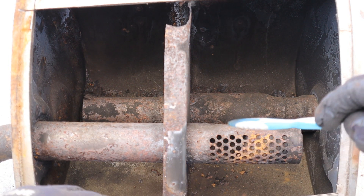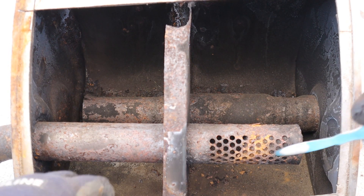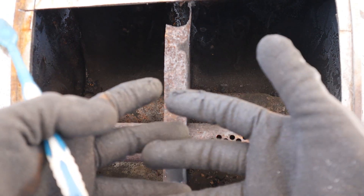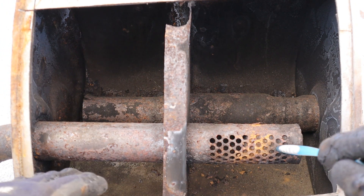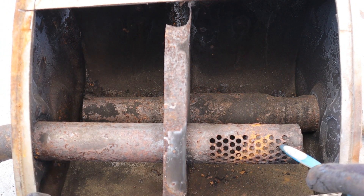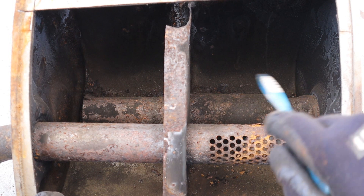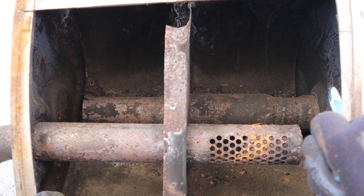There are some perforated holes where some exhaust gases are then going to escape into the first chamber. At the back of this pipe it's actually blocked completely with a glass-packed fiber. These fibers are fine little strands which are going to vibrate at different frequencies and cause them to come out of phase. When the frequency of the sounds are out of phase, you get destructive interference. All of that sound and exhaust gases are going to be trapped into this first chamber, where they're going to bounce off the front wall and rear wall and cause destructive interference with the sound.